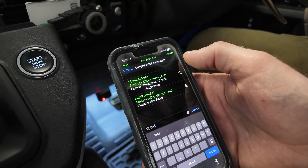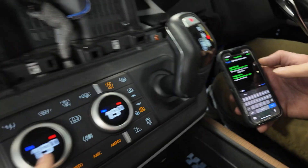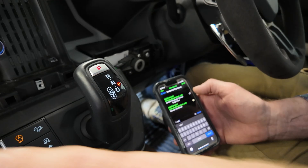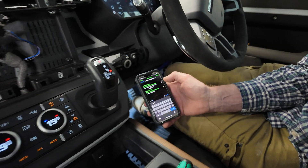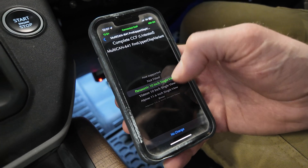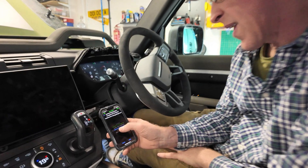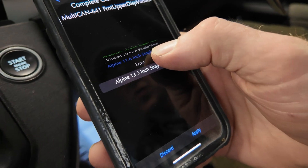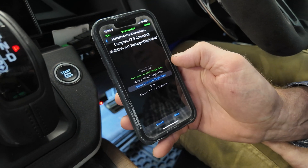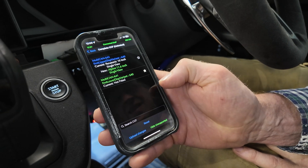We've got 'display variant'. There are two 641 entries — upper and lower — which seem to relate to front display positions on some cars with extra screens for air con and seats. We're on the main one. At the moment it's saying we have the Panasonic 10 inch. We need to change that to the 11.6 inch. You also have the option for a 13.3 inch, but that'll be another video — that's the one fitted in the new L460. Let's apply that.